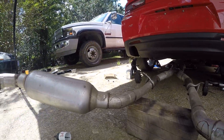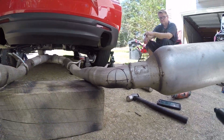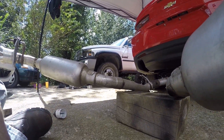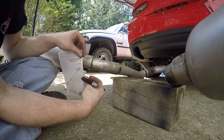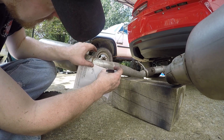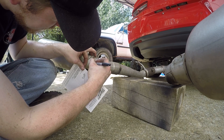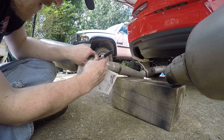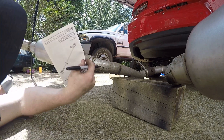Alright, as you can see we have the exhaust out. You can see where we marked the outlets that we're going to cut. I've got kind of a cross going and a center mark — I'm going to show you how I did that on this side and that'll get me close enough to center for what we're doing. I'm sure there are probably better ways to do this, but this is what I do. A lot of it is eyeball, but that's okay. Essentially we traced around there, then we find the opposite side — the furthest point from it. You move the marker until you get to the farthest spot away, hold it down, and just draw a line. You do the same thing vertically.